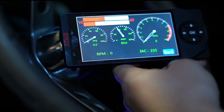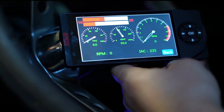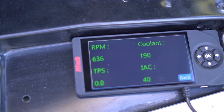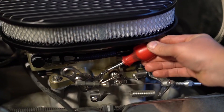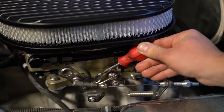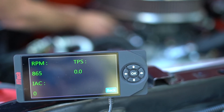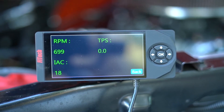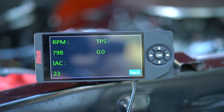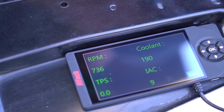The engine's not running right now, which is why it reads 235, but when it's running you may see something around 40, 70, or 80 — somewhere in that range is likely what you'll see. If the value is high, we're going to turn the throttle adjustment screw in clockwise to open up the throttle. If the value's at zero and the engine's idling fast, we're going to turn the throttle adjustment screw backwards to lower the idle, and that will make the IAC start to come up. With the engine at operating temperature, we're targeting somewhere between 3 and 10.